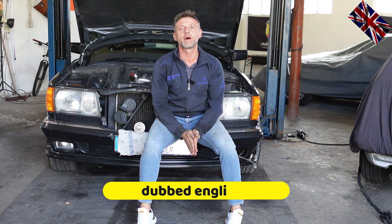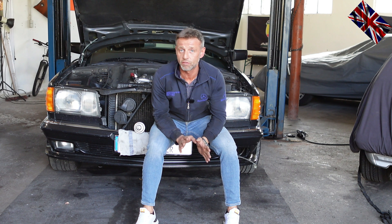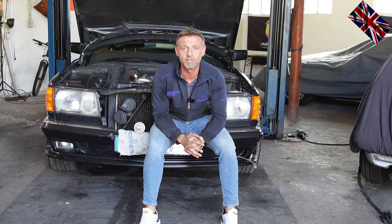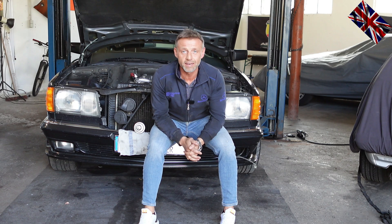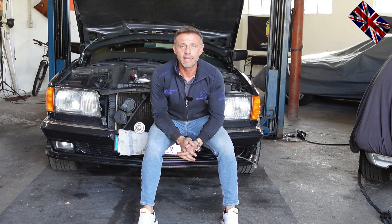Welcome back to our 107 channel. Today's topic: hot engine does not fire up after 10 minutes — you need to crank for 30 seconds or more. We had that topic some weeks ago, repairing a Baby Benz W-201 with K-Jetronic. We changed the front fuel pressure accumulator sitting close to the fuel divider and the issue was gone. Some of you commented that this fuel pressure accumulator is no such thing but a fuel pressure regulator — the one sitting beneath the rear axle.